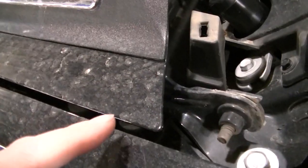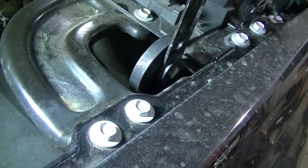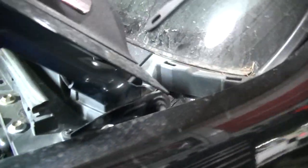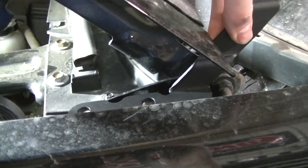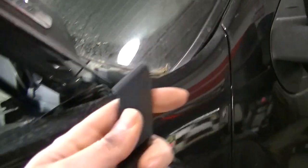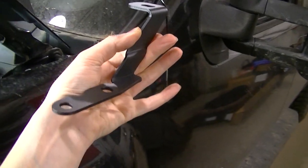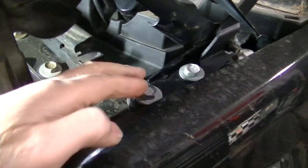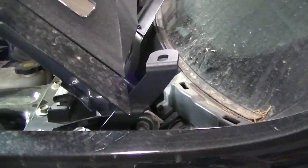Then you've got to reopen the hood because the two bolts you're after are right there. With the hood reopened, those back two bolts right there are what you need to take off. You're going to put this bracket in place, slide it under here, and then bolt it down to those bolts — put the bolts back in. Make sure you're using the right bracket for the right side. The light bracket will go towards the center of the truck. It doesn't get much easier than that — bolts come right out, bracket falls into place. I would suggest you open and close your hood to make sure everything is clearing the way it should.